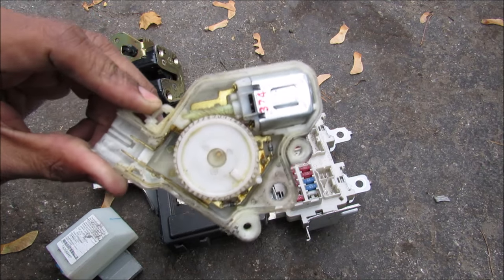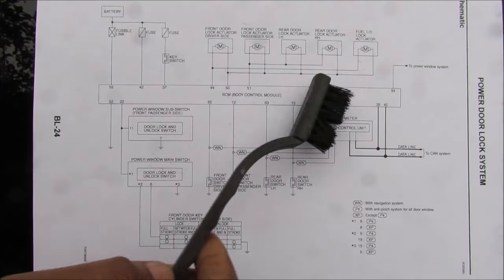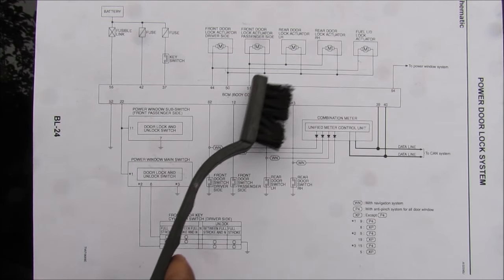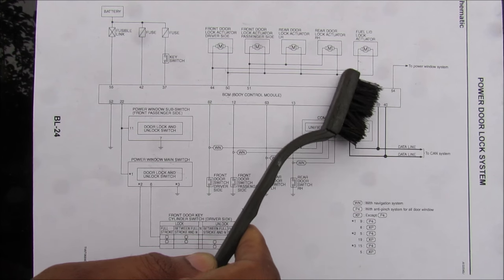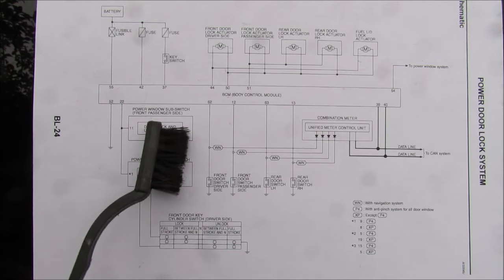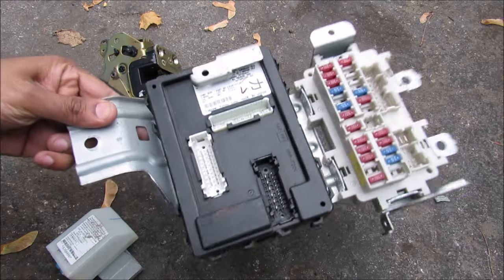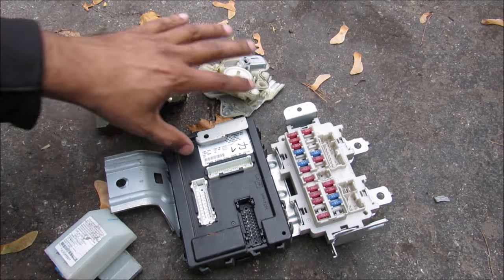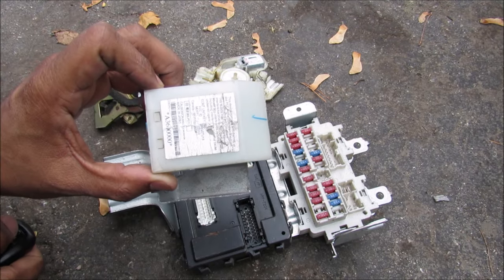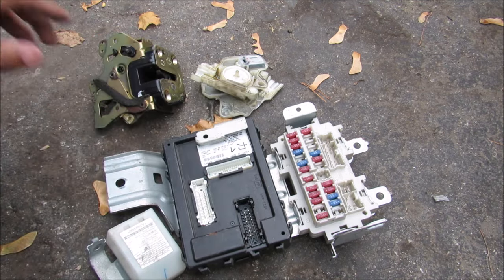While that mechanism covers the mechanical side of the power door lock system, the other aspect is the electrical side. Here we have a schematic diagram with the body control unit in the middle, which takes power from the battery and sends it to each actuator to lock or unlock the door - it also unlocks the fuel lid actuator. This is all controlled by the lock and unlock switches on the driver or passenger door and interfaces with door switches on each door. The body control unit, typically located under the dashboard near the fuse box, controls the entire door lock system as well as other body functions. A remote control receiver handles commands from the keyless entry and sends them to the body control unit.